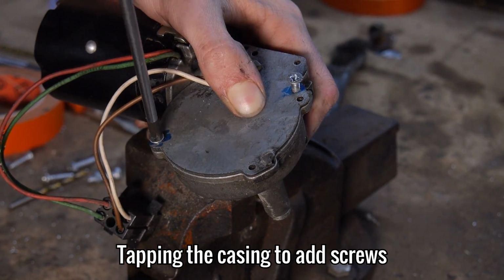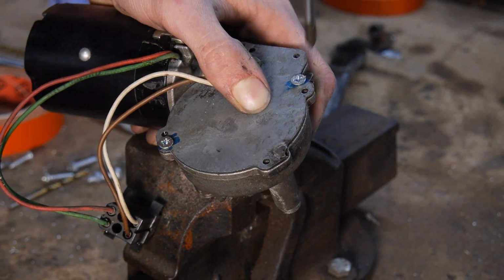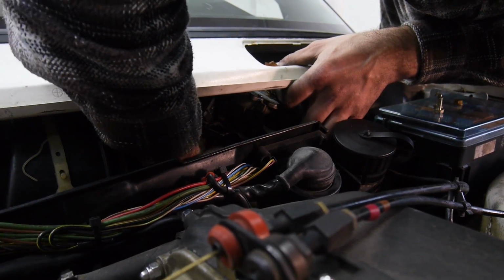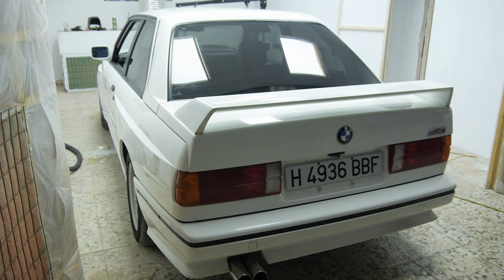It was at this point I asked Tony if he had checked the relay. His answer was no. I immediately went and got one from the Coupe that I knew was working. We fitted it to the car and the problem was solved straight away. We probably should have checked that first, but hey ho, problem solved.